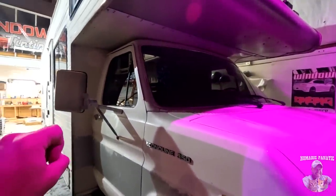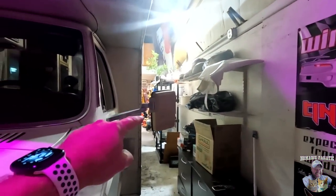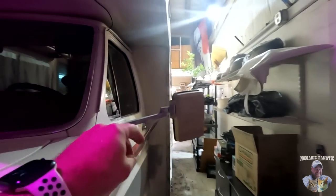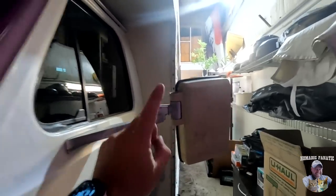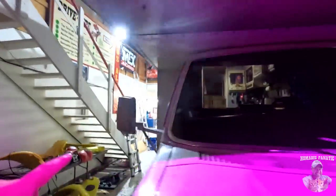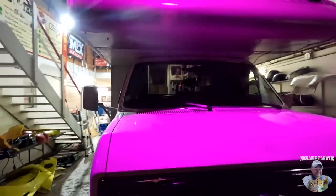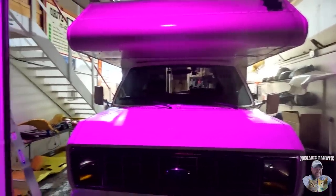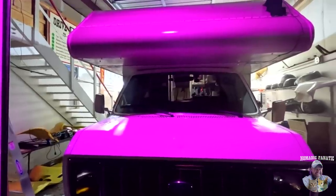A lot of people ask me about the mirrors on my RV. See how on the passenger side it's right there by the window, but if we go over to the driver's side it looks like it's opposite and lower. I just wanted to show it's the same exact way on Wayne's - they actually did this for a reason. On the driver's side, your view is not obstructed and you're not blocking your blind spot, so they put it lower. But on the passenger side, if it were lower you wouldn't be able to see over it, so that one had to be higher. It's more of a Class C thing from Fords in that era.